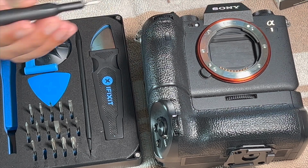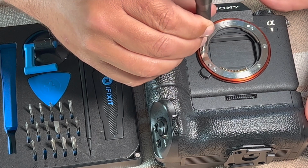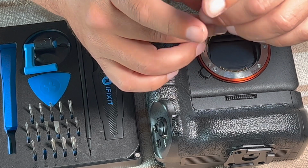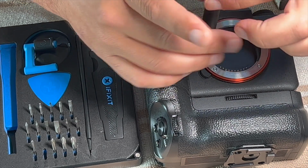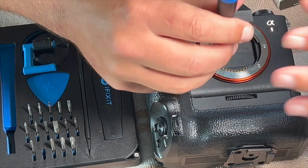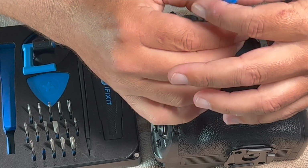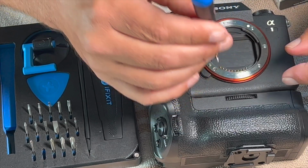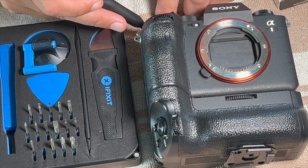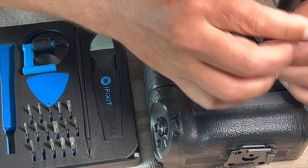I'm also going to put the screws back. I was an automotive technician, and if you reuse screws, you'll typically put them back where you got them from, because threads do get stretched a little bit even if you torque them to the proper amount. So if you put them back exactly where they came from, you'll get less distortion when you put them back together. Yeah, all of these screws are already loose. They're coming right out with no problem. This nice magnetic screwdriver is working well.